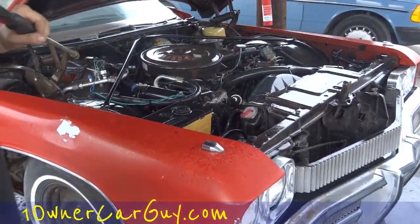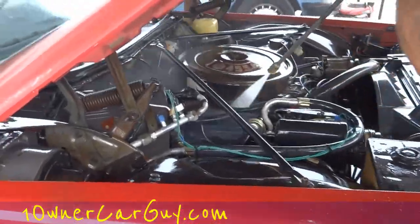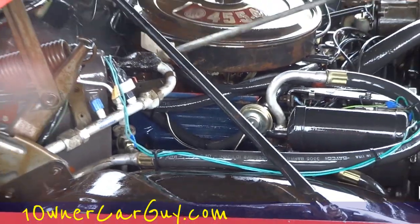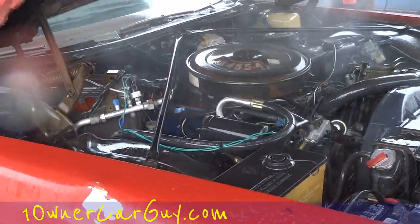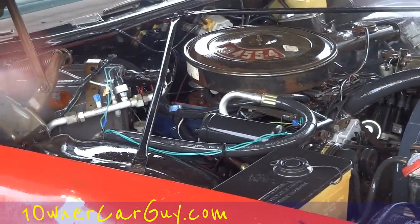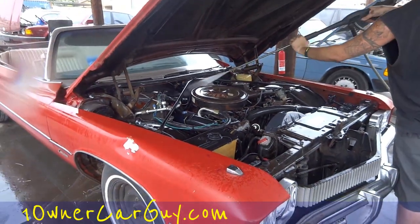One of the most important parts to get is the valve covers and around that area, in case there's any leaks. And what this does also is it really helps us on the other end when we're looking for leaks. When this stuff's nice and clean, now when I get this thing all running right and drive it around, I see where a leak is. It's easy to locate it. And from there, I'll be able to fix it if it's a valve cover gasket or, you know, that type of thing. Also, sometimes, just so you know, it can cause a leak and you can break a gasket.